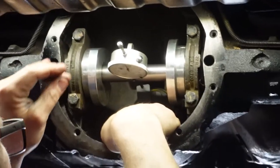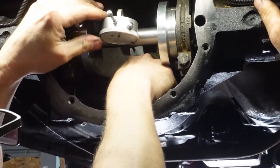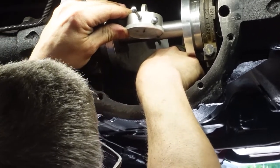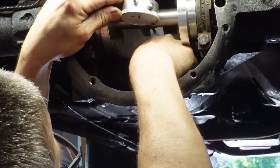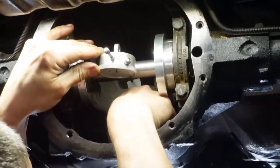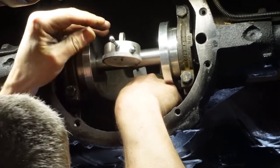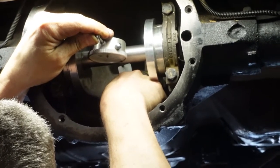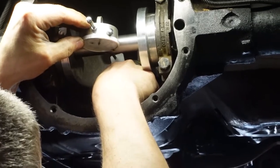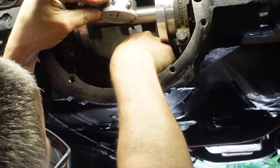So like I told you guys before, he didn't really like where the pinion was sitting by the feel, so we decided to bring out the old shims and go ahead and reinstall them. Then he's going to measure the pinion height and do some more of the maths. This is what determined that he didn't like the 36, and I believe this is when he went to the 26. You'll see us popping the bearing back off, and he's going to change that to get the backlash right. He was doing maths on this, basically.